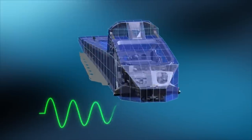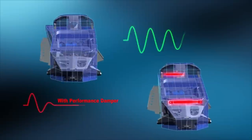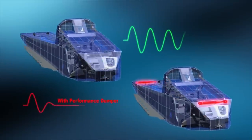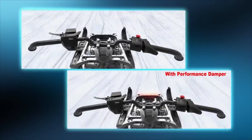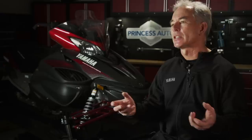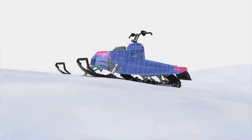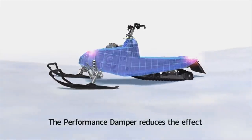The shock's maximum movement is about 20 millimeters, but in application it very seldom moves more than one or two millimeters — that would be at more low-amplitude movements, in other words, flex in the frame. Most of its benefit doesn't come from controlling flex; it comes from controlling all the vibration and resonance going on in the frame. That resonance oftentimes means you're going to measure the movement in the shock by microns — very small movement, but moving very quickly at a very high frequency.